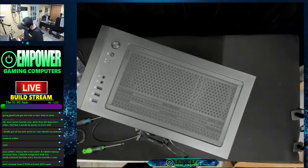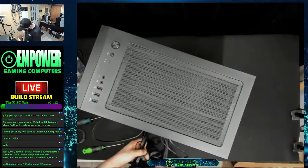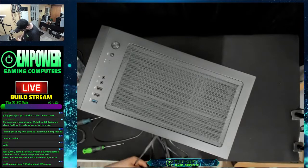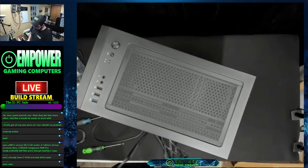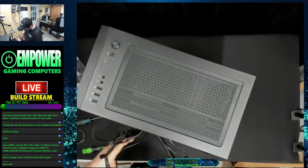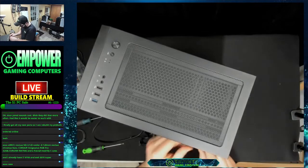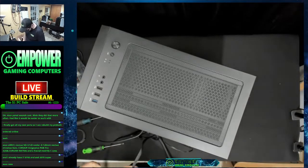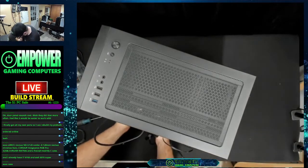That'll be a solid upgrade, sir. I can't remember what case you were in, but I think it was like an iBuyPower or something. You'll have much better airflow. Your temps will be so much better. Although if you have been running that 9700K inside that PC for a while, it might be something you want to look at. I don't recommend delidding unless you are confident doing it, and redoing the thermal paste below it. Do not do it if you're not confident in yourself. Don't even try. You could really screw it up and may not even be able to get it back on.